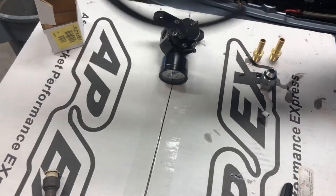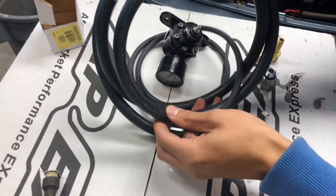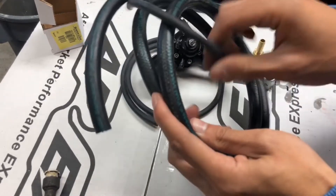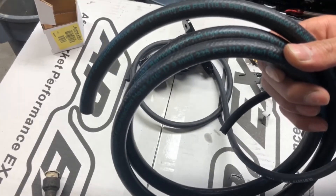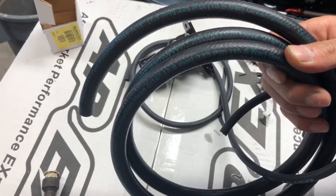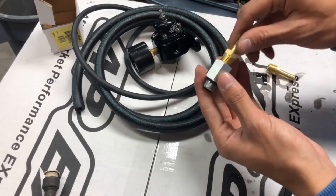When using hoses it is important to use hoses meant for gasoline. If you use a hose meant for coolant, for example, it could degrade over time and create a very big problem in the engine bay. This particular hose we are using is rated for gasoline and has a 5/16th inch inside diameter. You can find what type of hose it is by reading the hose itself. This hose is also rated for 225 psi, which is well within the range of 60 psi for this engine.